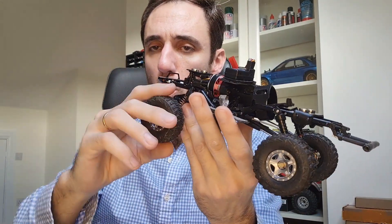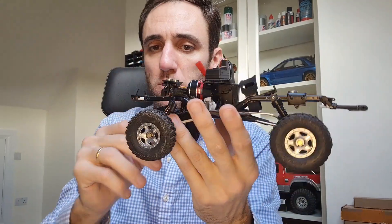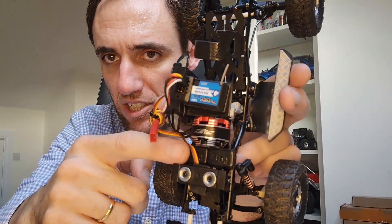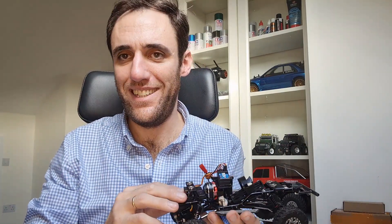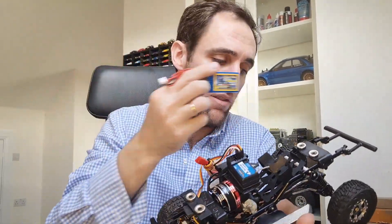So as I was having some weights on the wheels, on the transmission, on the body, and on the chassis too, it was a heavy rig and with the motor adding so much torque to move it, of course it was twisting. I still need to test if I can, with the Bluetooth app, remove all the FOC effect and see if the torque twist is gone running on 3S. At the moment, what I did is just plug in the 2S LiPos instead of the 3S ones, and now the torque twist is almost gone.